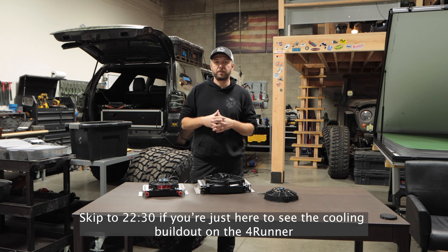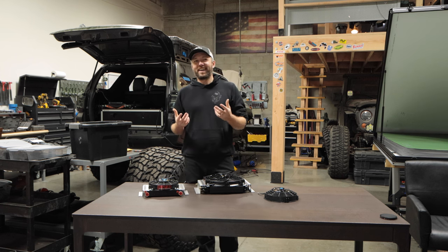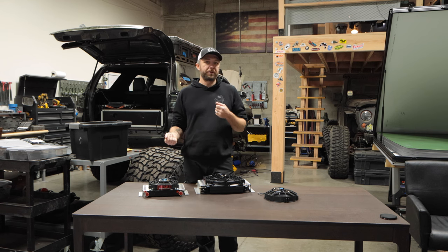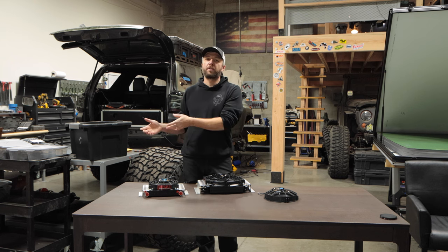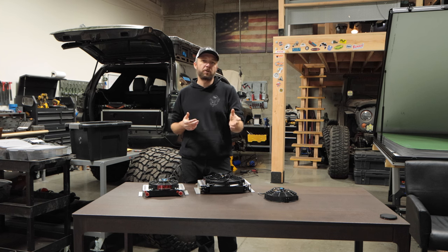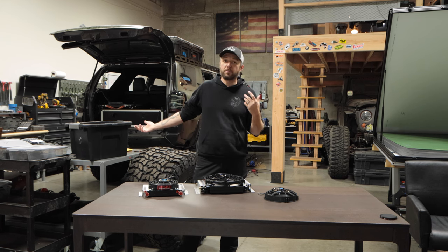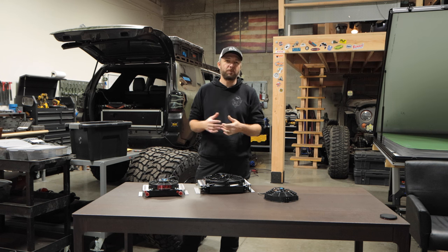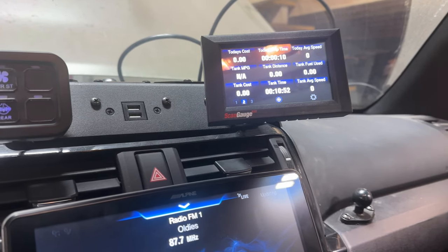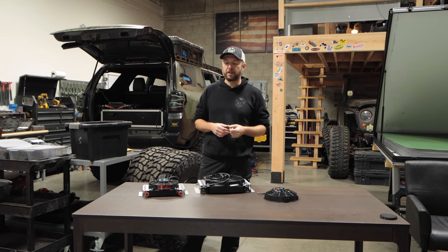First, let's discuss what causes overheating issues. The first one is not going into S-Mode, which is basically moving your stick shift into S-Mode. Sometimes you need to be in third gear, second gear — you need to control those shift points. A lot of people, like soccer moms, just don't know what S-Mode is, and that's going to cause transmission overheating issues. My best solution is install a scan gauge to monitor your transmission temps.